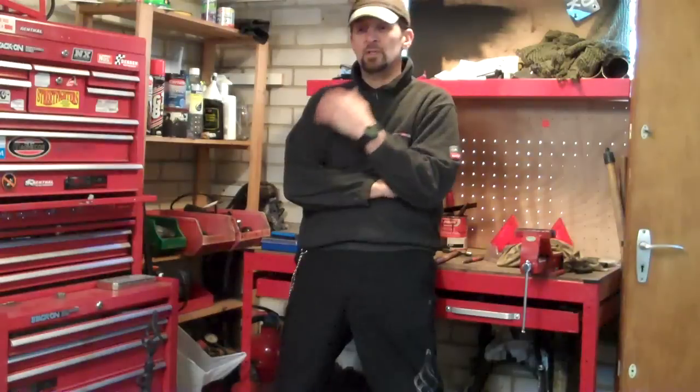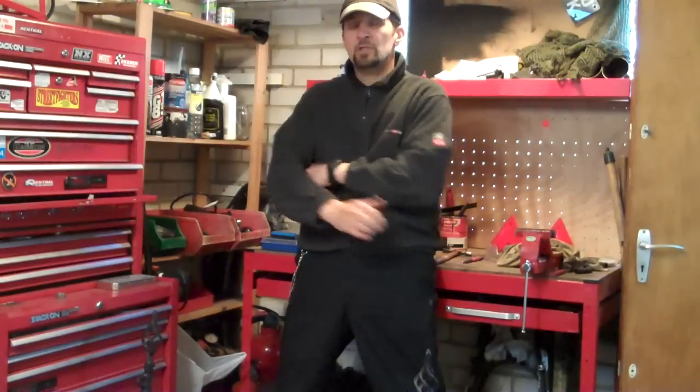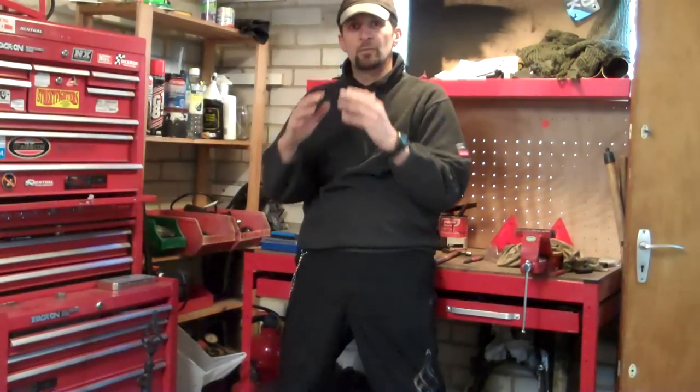It's pretty cool. And obviously tire pressure is very important in the winter because they don't get hot. So they don't get soft. So they're not malleable. They don't grip as well. So the tire pressure is essential to keep the carcass shape correct on the road, which is essential to keep the bike on the road.